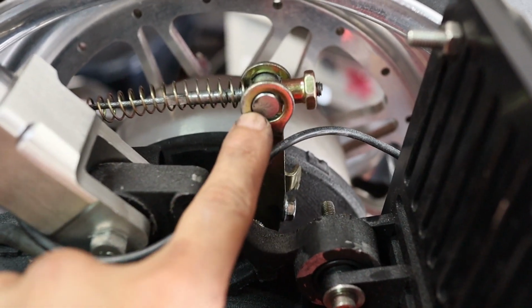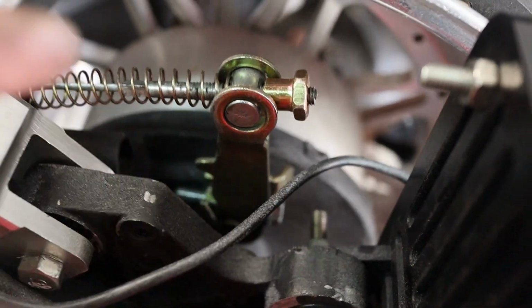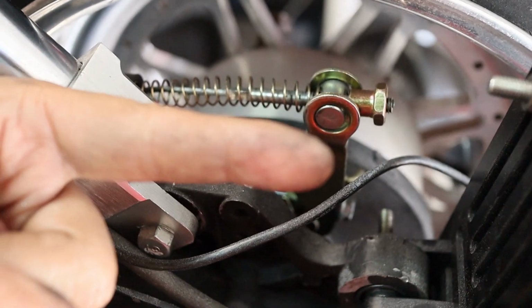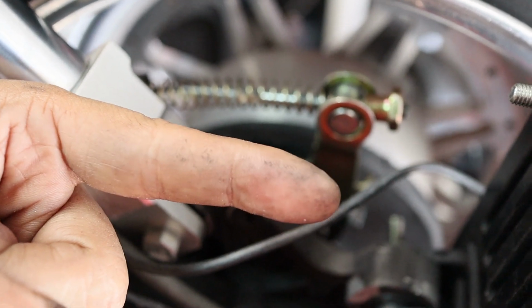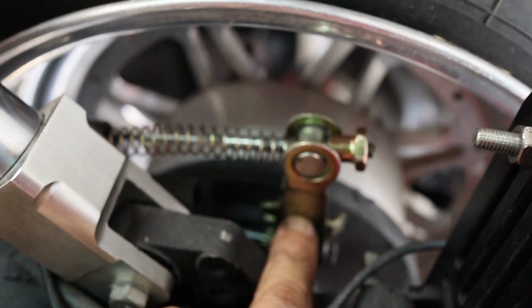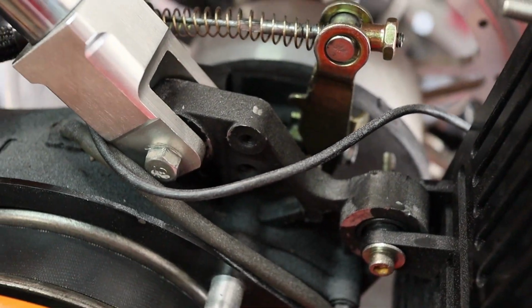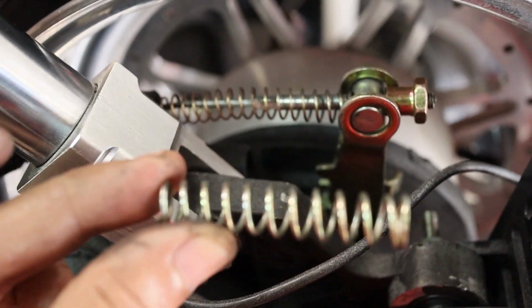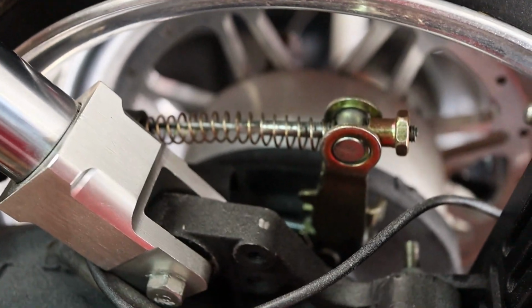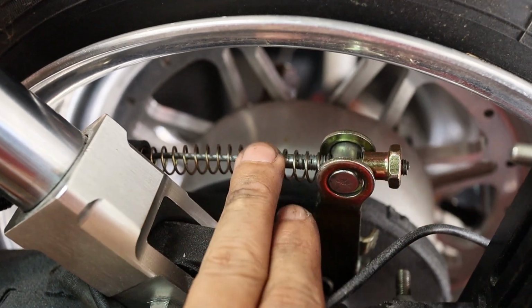I'm back. Okay, so I went ahead and adjusted this, and I also realized that the spline this is connected to on the bottom can make your brake pads be further out in the drum or inside the drum. So what I did was I pushed that peg in as far as I could and then clipped it onto here. And then with a little bit of adjustment, I put a bigger spring in here. The spring that this cable came with was too short, so I had another cable and I used a longer spring, and then this end was a cooler color. So now when I spin it and I pull the brake, it stops.